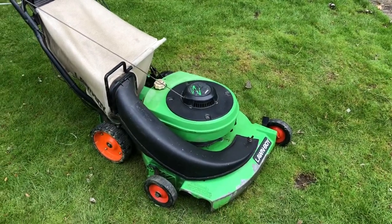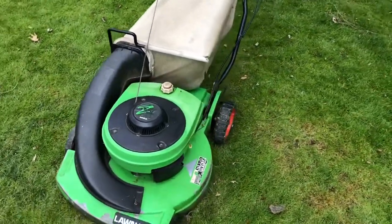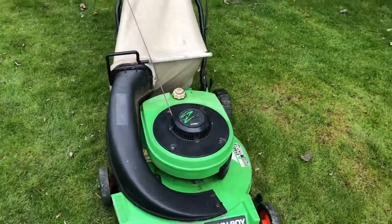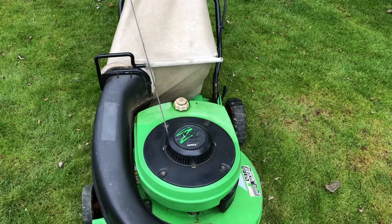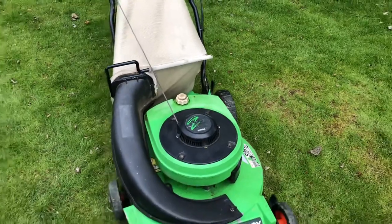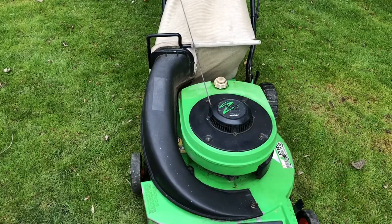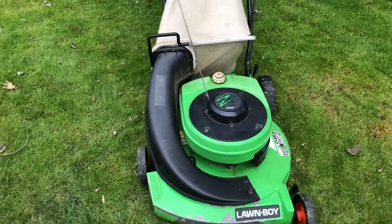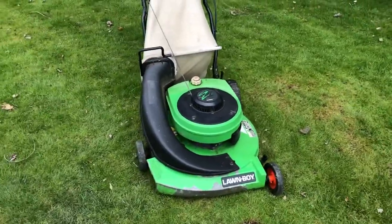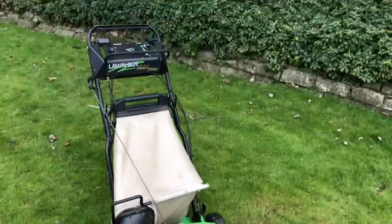So this mower is not going to be staying with me anymore because, like I said, I do mow lawns. I mow about 10 lawns and they are bigger yards, so the machine gets used pretty heavily, especially in taller grass. And the engine is not the most powerful, being only a 4 to 4.5 horsepower. I even have the engine sped up about 200 RPMs over the manufacturer specification. And no, that did not damage the seal by any means. I only turned it up whenever I had to do very thick grass. Most of the time I used the throttle control on the handle.